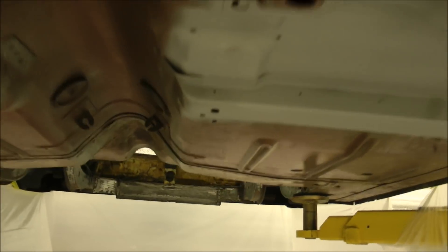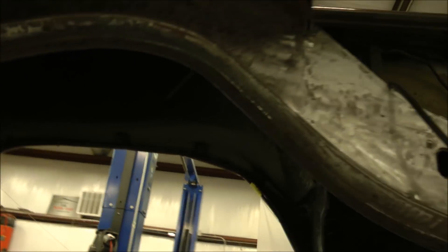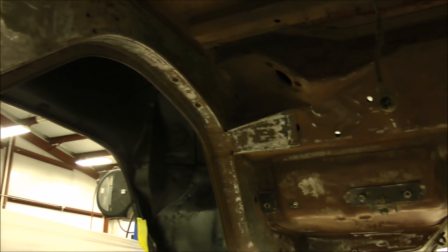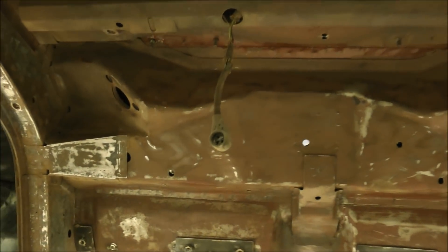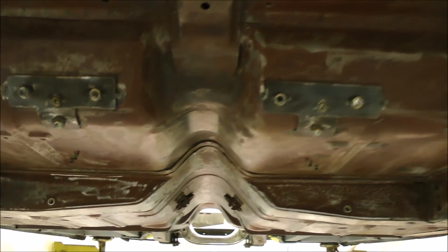We're back to plastic-hanging the car because it's time to put epoxy primer and chassis black underneath. All the new floor pans and the trunk area are done — suspension's been removed, the trunk area has been cut out and the metal cleaned up. Before we put the rear suspension system back in, I want to get all of this nicely done in epoxy and chassis black.